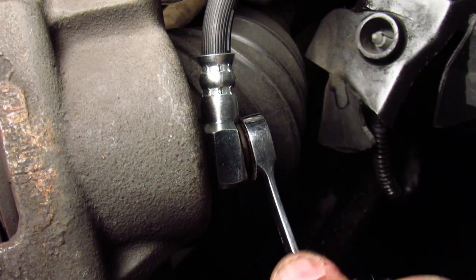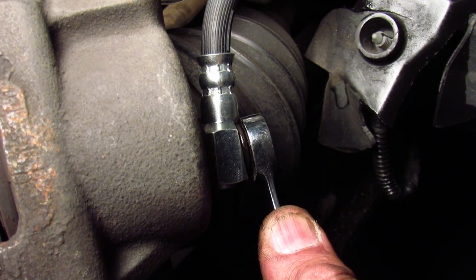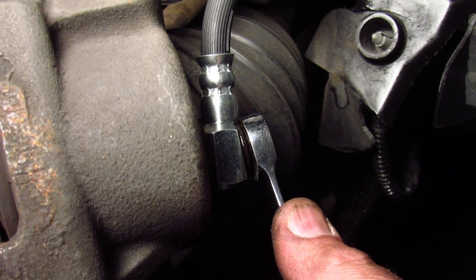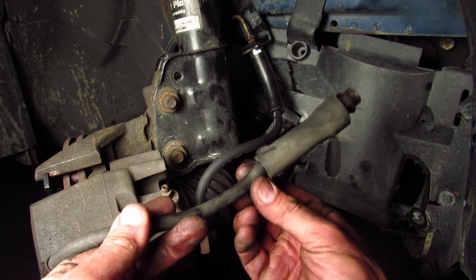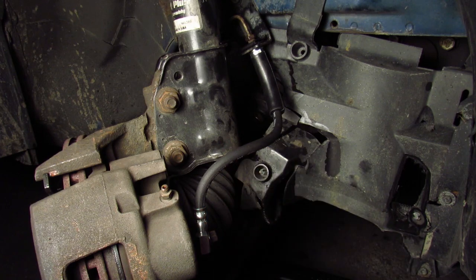And now I'm going to tighten the bolt on the caliper. Again, you don't want to over-tighten it, but you want to crush the crush washers, and you'll check for leaks later during the bleeding process. Speaking of the bleeding process — it's late, the lighting is bad, so I'm going to skip that part. You're going to have to find another video on YouTube about how to bleed brakes. But now we have a nice, new, supple brake hose that's going to be a lot safer than this old bubbled-out one, and it cost $12 and took about 15 minutes to install. Thanks for watching.